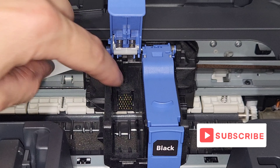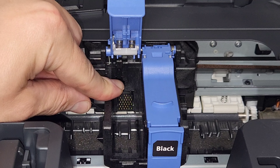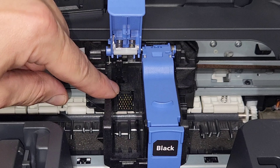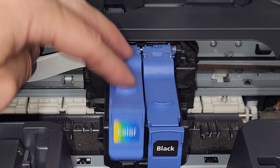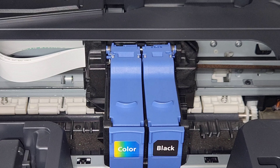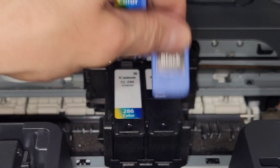You need to be very careful so you don't break any of the pins when you're cleaning. Don't be very rough on that. Just tap with a paper towel, or an alcohol swab would probably be the best. Make sure the printer is off and unplugged when you're doing that. When you're done cleaning, let it dry also, then plug the printer back in and install the ink cartridges.